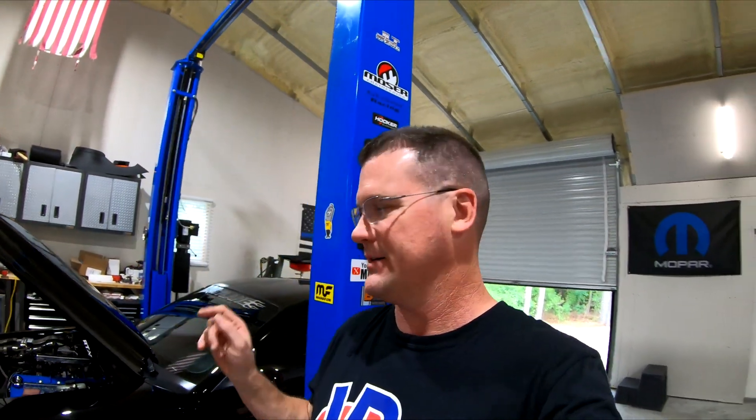So I hope that helps — if you've got an electric fan that quit working and you check all the fuses and the basic stuff and it still doesn't work, it's probably the CCRM box. Till next time.